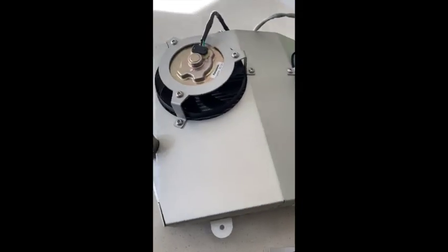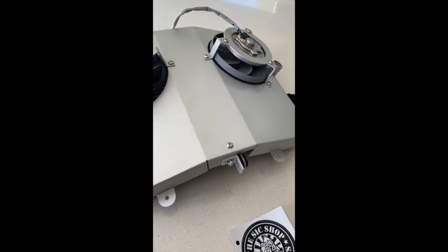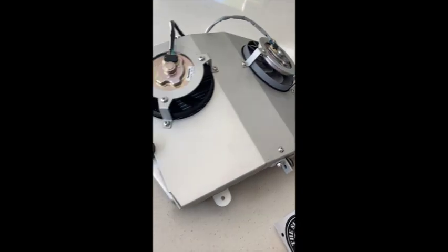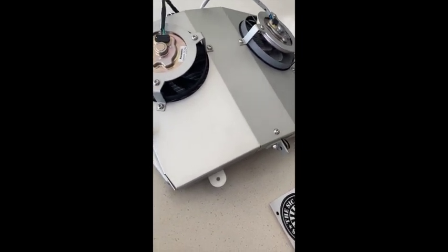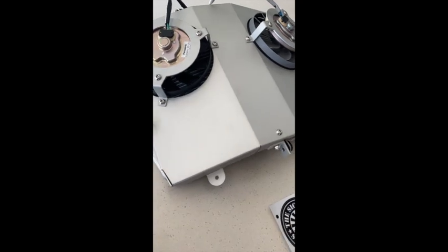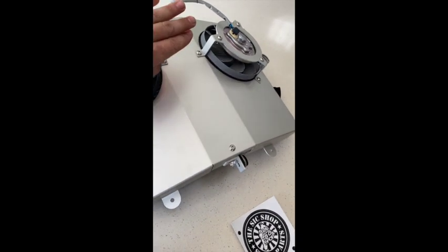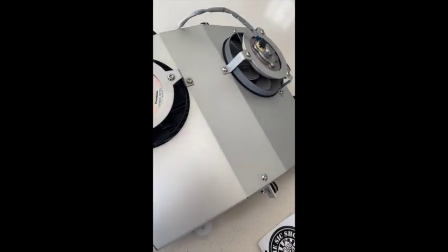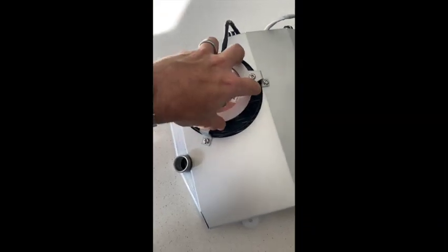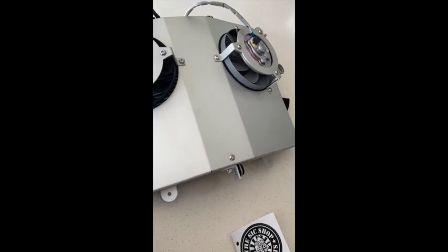I've had this idea for about seven or eight years. I've had trouble with my ZX6 overheating — my 2013 — and I just know it's an issue with these bikes. I never really understood why they didn't have a fan shroud, because that's what works on race cars. If you can separate the air coming in from the radiator from the hot heat headers located right here, and have a fan shroud that makes a vacuum and pulls air through the entire face of the radiator instead of just in front of the fan blades, it just makes more sense.